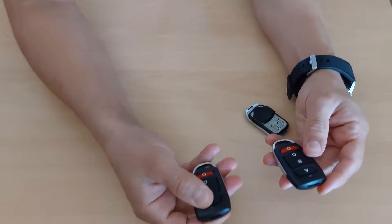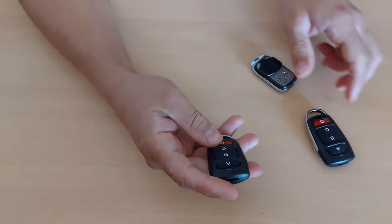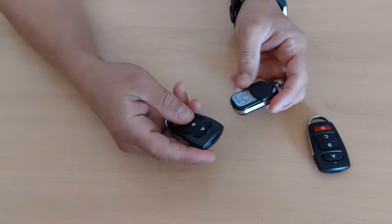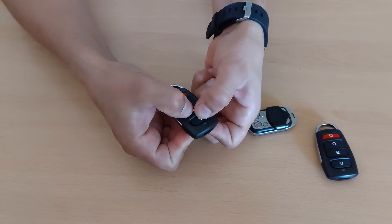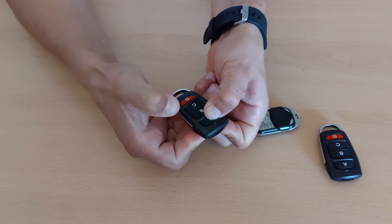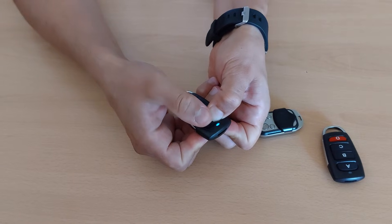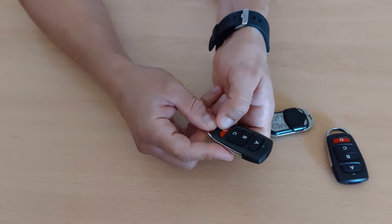The same I did with this one — A and B, C and D. Let's do the same process with this one. First of all, press these two buttons; A button has to be pressed all the time. So press both buttons like this, then one, two, three. Now all the buttons have the codes cleared.